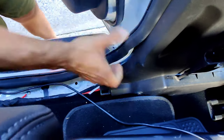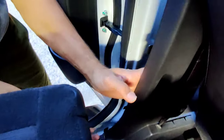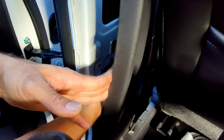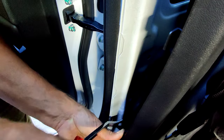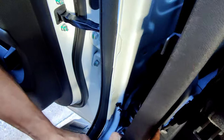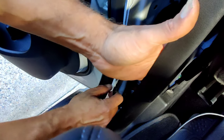So we're just going to quickly pull this trim off, pull the door seal off, pop the panel so that we can pick up the cable going to the motor, which is feeding down here. There it is — this harness here should be it. You should be able to get a tool and pop this like so from there. I'm trying to do it without removing the whole panel so it's a bit easier.